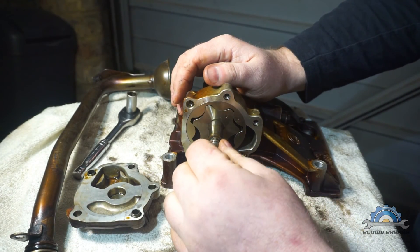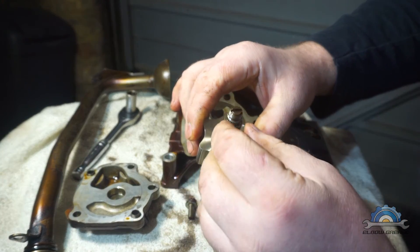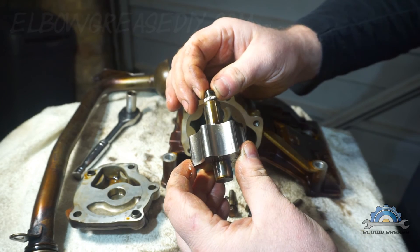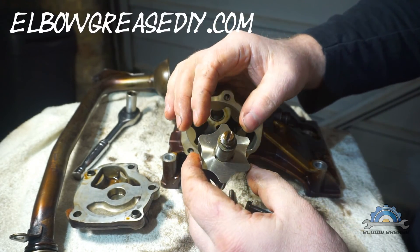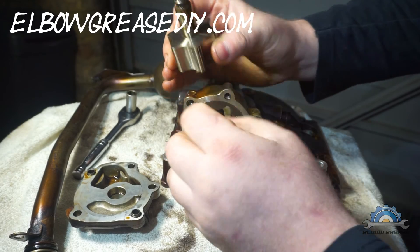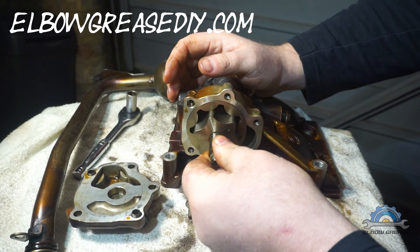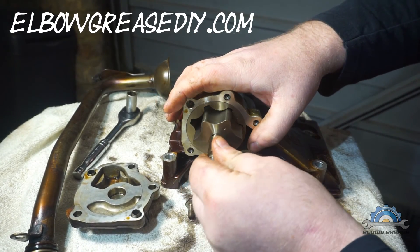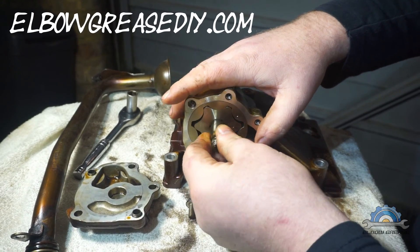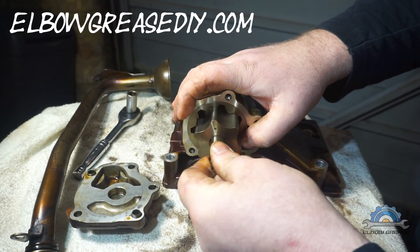The main inner rotor can be bought separately from BMW, as can the outer one. I did that on my M54 rebuild - you can check that on my website elbowgrease DIY and see the pictures in the ring section of the menu. Note the alignment dots: one dot and another dot. If you don't align them properly they won't fit - they only fit when the dots are close to each other.